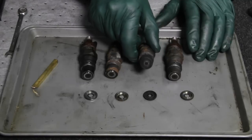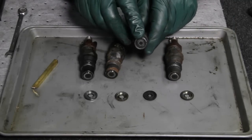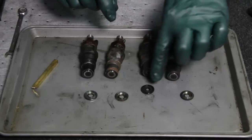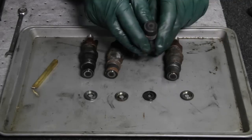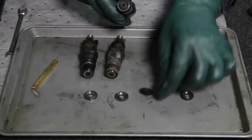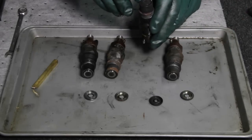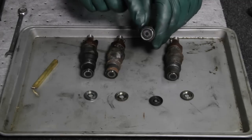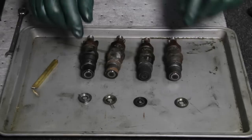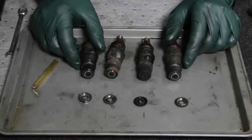You can see there's a little bit of carbon coking around the tip — that's normal. But take a look at number two. You're thinking, Kent, why is that all black and carboned up? And that's the first thing I thought too. This is probably the original heat shield. You can see what happens when you try to install a fuel injector and reuse an old heat shield washer — you're not going to get a proper seal. You're going to get a poor burn and possible injection compression leak, so that's something you want to watch out for. Now I'm going to take a quick look and determine whether or not I should even bother bench testing these.